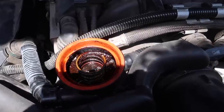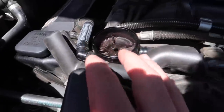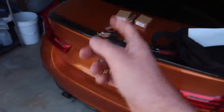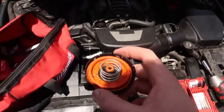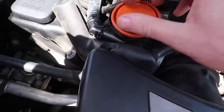Destroyed — oh my god. So I'm gonna have to clean all that out and then we're gonna have to replace all this. I just cleaned that one out to the best of my ability and this one out to the best of my ability with the tools that I had here. I think it'll be perfectly fine. Let's just go ahead and throw in the new gaskets and the new seals. I'm super stoked about this because this should fix my idle issue. Just put the ring in just like that, put the gasket on just like that. Oh, that looks so much better.